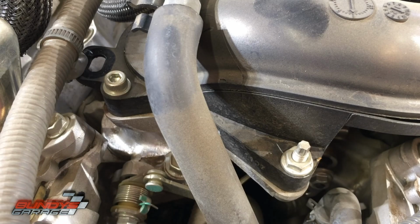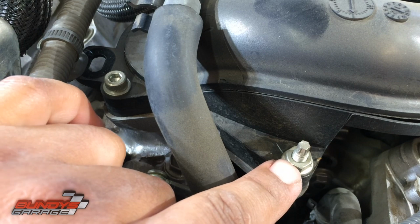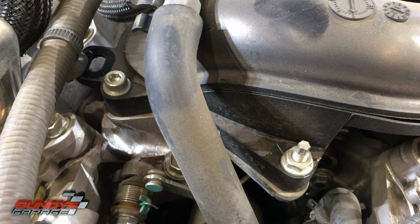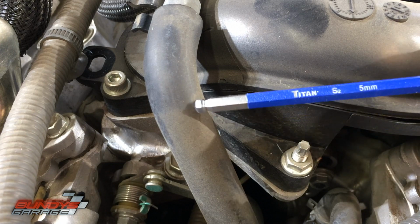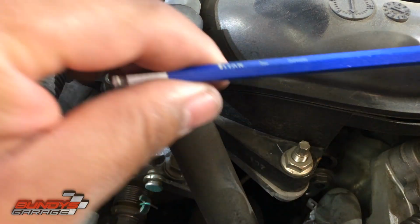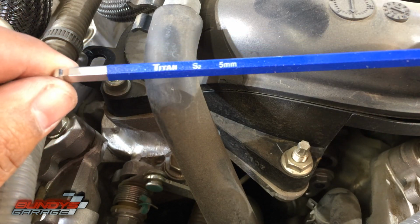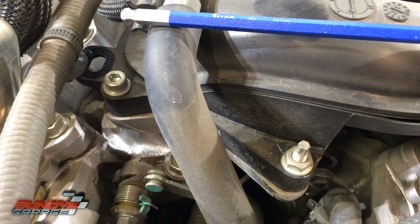Okay, so starting to work on the upper intake manifold. You have two 10mm bolts here. The rest are these tiny little Allens, and the Allen size is 5mm. I have this long hex key set that I got from O'Reilly Auto Parts. I'll put a link in the description below. All the tools that I use in this video, I'll put a link in the description below.